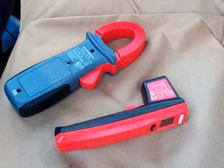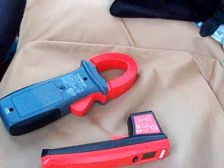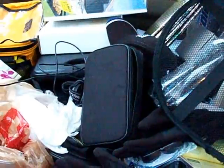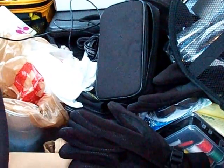So they're about an amp apart. I'm going to shut the video off now — this concludes this video. I'll start it back up once the car is warmed up. Right now the alternator is putting out 14.4 to 14.5 volts, and the water temperature is 64 to 66 degrees. Stay tuned for the next video on the cold-weather operation of this Green Fuel H2O 19-plate V6 system. Thanks for watching.